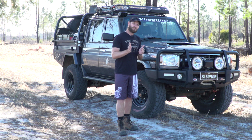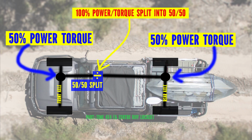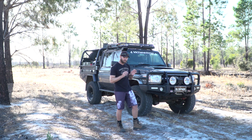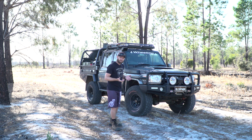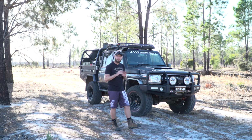And the more turns you do and the longer you hold it for, all these stresses and energy cannot be released, because when you lock it into four-wheel drive, it's locked. You're locking 50% to the front, 50% to the back. No power exchange can happen between them. There's no difference can be made, like a differential. So this bind up gets worse and worse. All the stresses will end up going into your transfer case and your prop shafts. Look, anything can end up going on your vehicle. You can even snap an axle from this. The bind up of energy needs to be released somewhere.